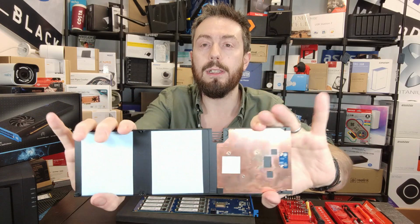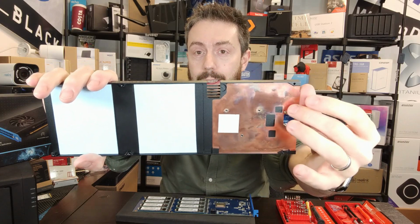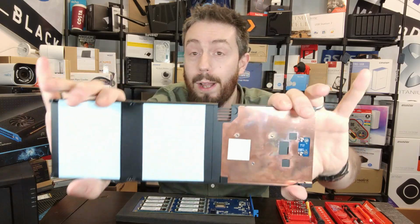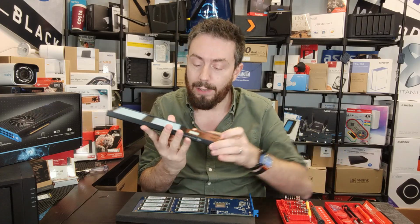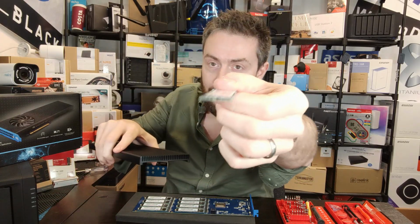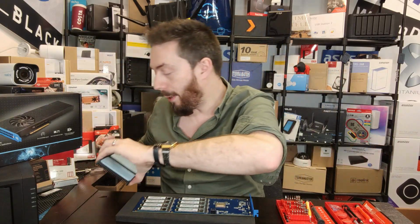So if we bring that there nice and close to camera without the light ruining it for us, we've got an enormous copper panel here to further assist the dissipation, and that is, by no accident, directly underneath the active cooling fan all the way through there. So again, huge amount of heat dissipation being made available there. And remember, this is not a thin heatsink there. To put that into perspective, that is how thick an SSD is. There is our heatsink there. So an enormous thickness there to that dissipation.